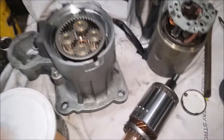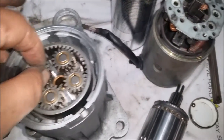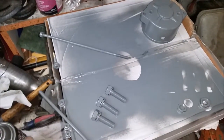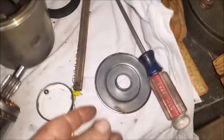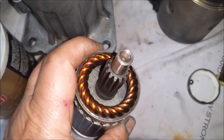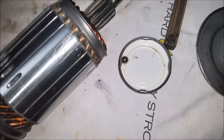I'm going to go ahead and reassemble the starter. I've already cleaned all this up, put all the gears back in, and dressed up all the brushes. I went ahead and painted some of the parts that will get corroded after I cleaned them up. When you go to put the starter back in, there's a little thrust BB right here that actually goes down in this hole. That's so when the starter bangs back and forth a little bit, it can still spin or pivot on this little ball bearing. So don't forget to put that back in there with some grease.